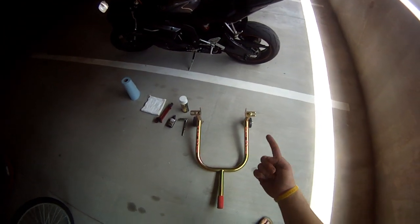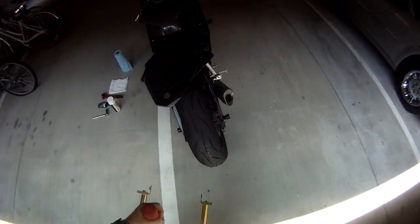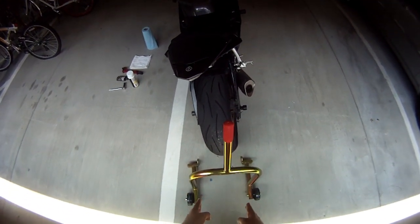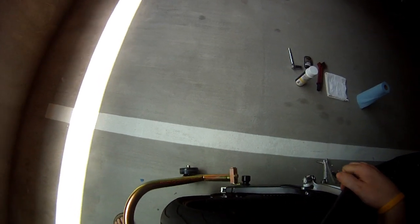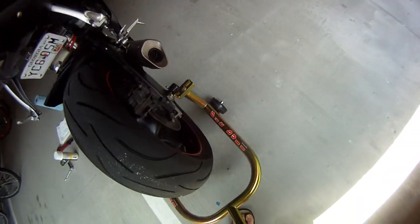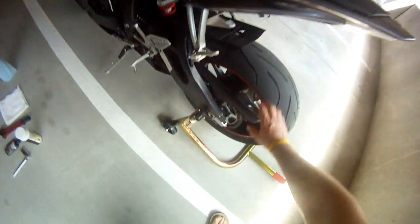The first thing we've got to do is get the bike up on the pit bull stand. Most of you have probably done this before, but in case you haven't, I'll show you how I do it, because I'm always doing this stuff one person at a time with no one else helping me. The bike is leaned over — this needs to be put on straight so you don't scratch your swing arm up. On my R6, I have this little area here. You pull the bike up kind of straight, get it in, and once you get one side it'll probably fit the other. Then you just push down and the bike will come up. It's in neutral — you want it in neutral so you can spin the chain.